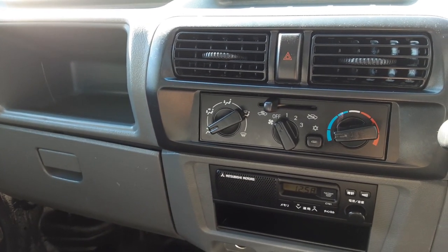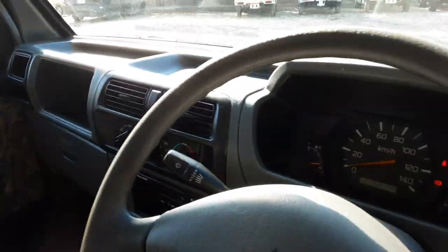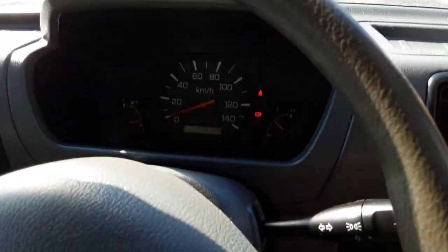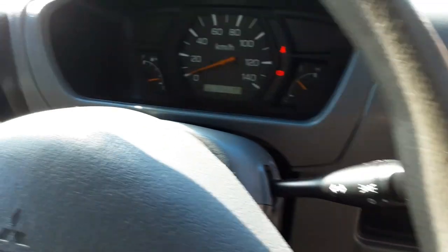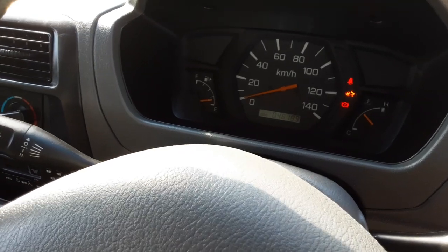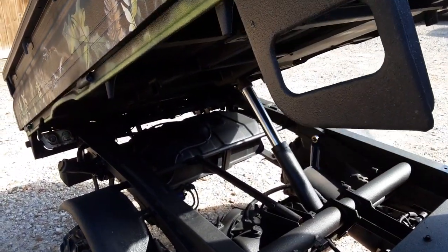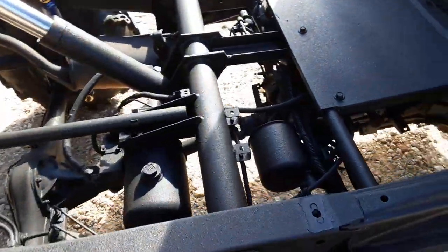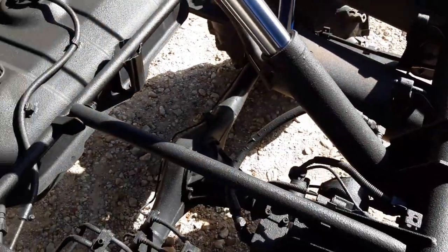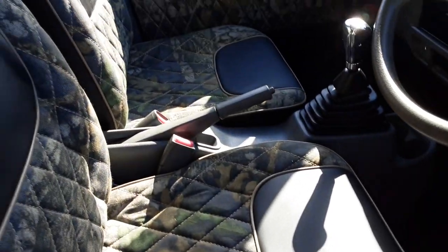Every truck I have has AC and heat, and it's going to be four-wheel drive. You can see the push button on the Mitsubishi down here. Now let me explain the dump truck feature — a lot of people don't really know how these work. In the Mitsubishi, you've got to hold this button on the upside, and what's going to happen — watch the light on the dashboard, it takes about three or four seconds — now you see that little dump truck icon pop up. That means the dump bed is ready to go up. That's a safety feature so you're not lifting the bed as you're going down the highway. And voilà, now we have a dump truck. We also put a new clutch in this truck. It felt soft to us, so we changed it. The truck goes through a very rigorous inspection — we check the brakes, everything. We take the drums, rotors, and all that stuff out, take a look and see what we've got.